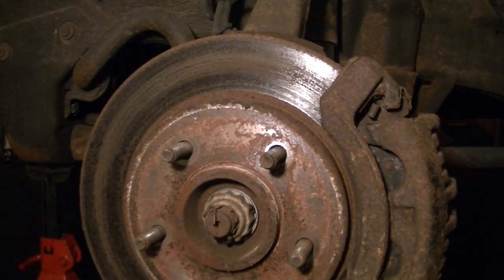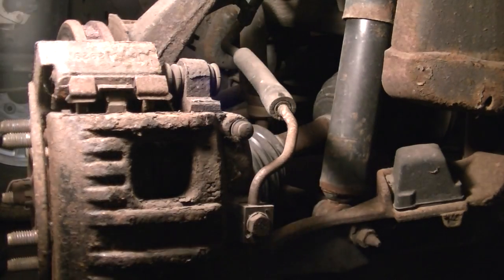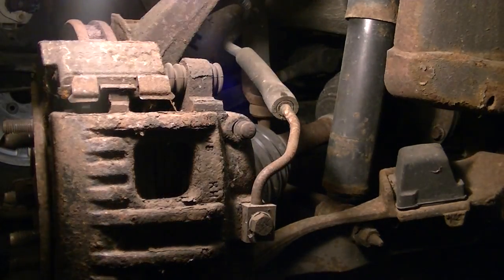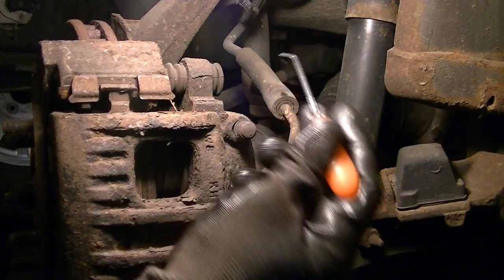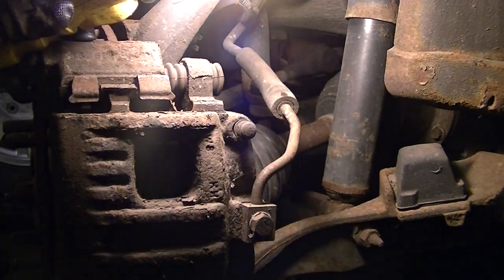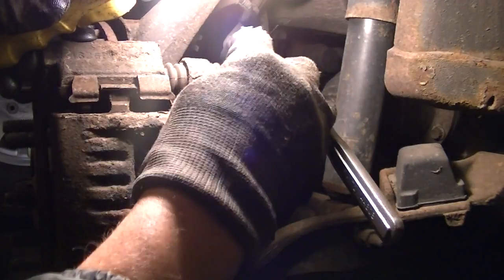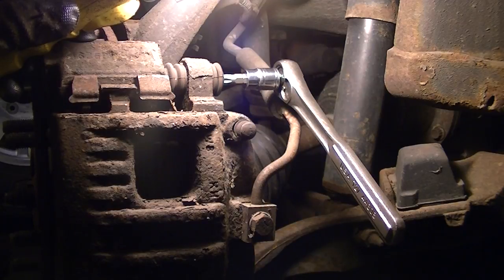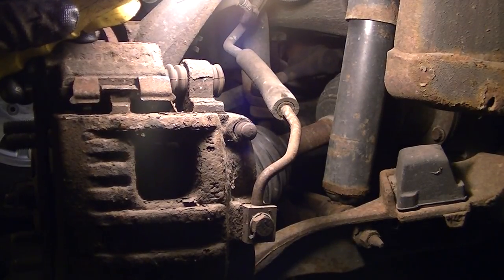The first thing I did was go inside and turn the wheel at an angle so when I'm working on the back here I'll have a little bit easier access into these bolts that have the star bit on them. Now this is probably the most important step when you're doing this brake job. On the back side of this bolt there's a star bit — stick the socket down in, take your pick and get in there and clean out any dirt and debris. Make sure there's no dirt in there, because you really need to get this socket all the way down in there. I've seen cases where guys put that in there and it'll start twisting and break the bit and strip the inside of the bolt, and then you are completely out of luck. If you break that, it is nearly impossible to get out. So I'm going to spin the camera around and look inside there and make sure that bolt hole is clean before we start torquing on it.